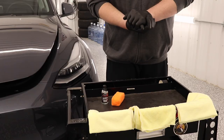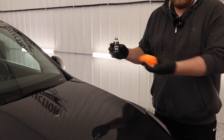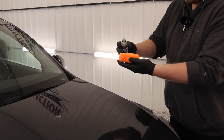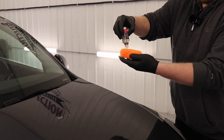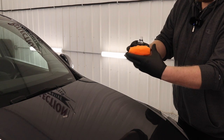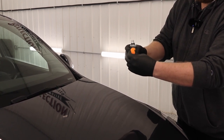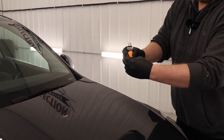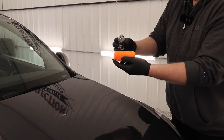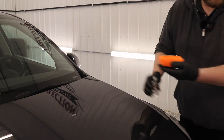So let's get into the installation. We've got our ceramic coating bottle here and our applicator pad. First things first, I'm going to prime the pad. Take the ceramic coating and pour a good amount on there — about like so. Then I'm going to fold the pad in half, and this is just going to prime the pad and get it ready for the installation. Now that the pad is primed, I'm going to put about eight to ten drops on — it's probably a little bit more than that.